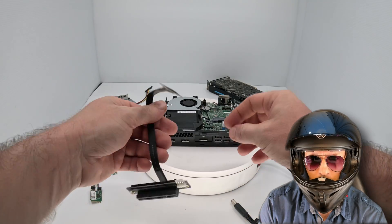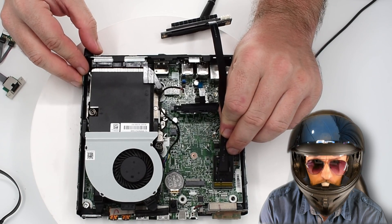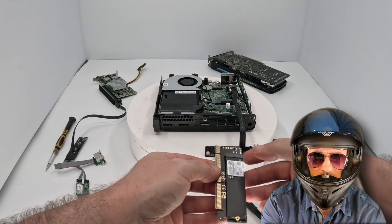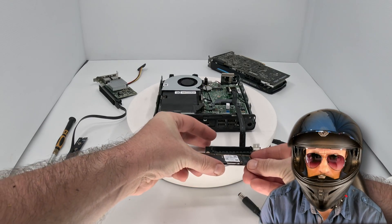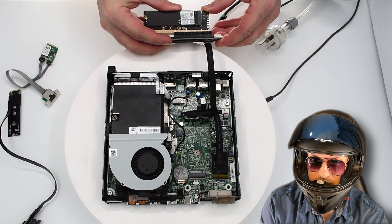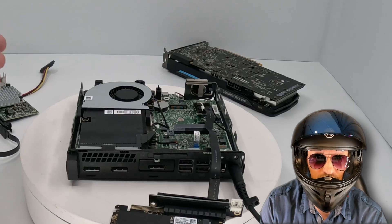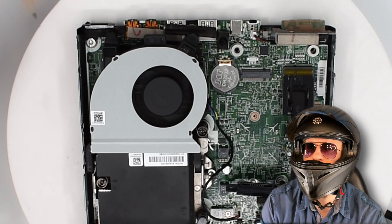This next one is a quite unique adapter - we're going to get an x8 adapter running into our M.2. Take note: this isn't the NVMe M-key slot, this is the A+E slot. I'm doing some quick testing to see how much power this slot provides and what I can get running. So we'll do something simple - can we put an NVMe on this slot? Indeed we can once we convert it. Let's connect up the power - safety first, especially when the machine looks a little Frankenstein-ish.